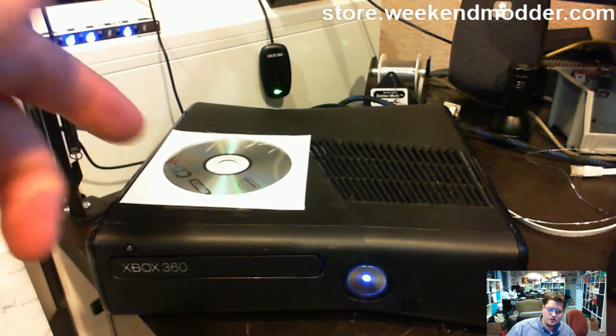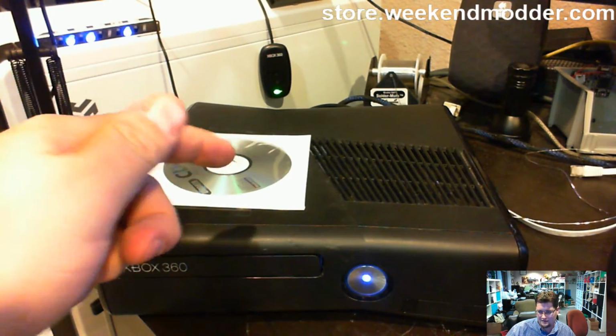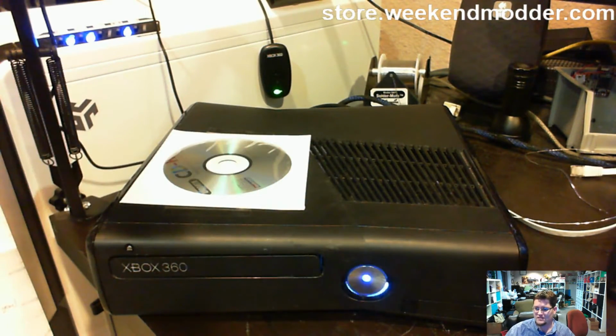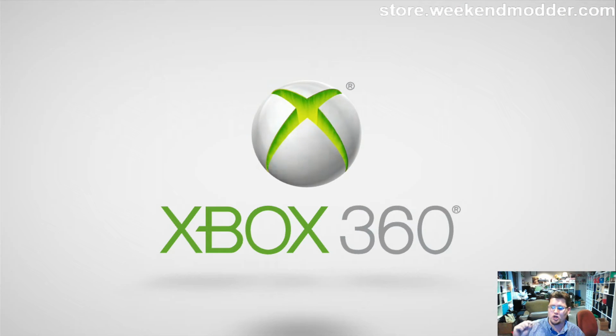And also mention, for those of you who might not notice, and if the mic can pick it up, I doubt that it can, there is a very short kind of buzzing sound, and that boot was actually fairly quick. That was pretty decent. It almost sounds like a chirp, but it's the fan doing a little bit of feedback noise for each cycle that the CR4 speed up chip cycles through. It's a real short blip, once per cycle, and once the console is booted it goes away. It's normal. So if you hear that, you're not crazy, it is normal.